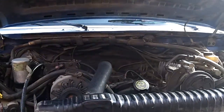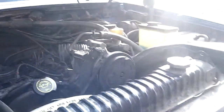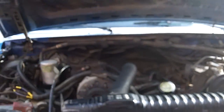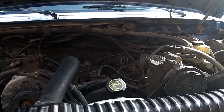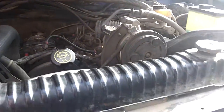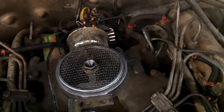Had to put a glow plug controller in my 7.3 IDI today because it's been getting colder and it's impossible to start when it's below 70 degrees. It just cranks and cranks, so the glow plugs don't work, so I had to put a new one in. This glow plug controller is that right there, $85 that was.